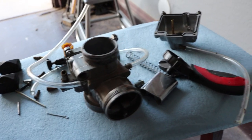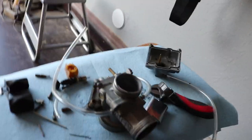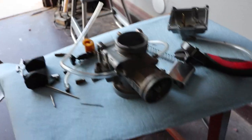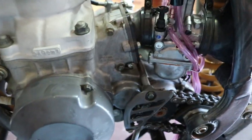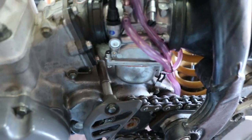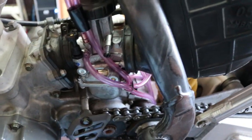Six and a half hours later. Alright guys, so we tried putting in this old carb but took it apart again, and the thing still idled like garbage. Changed some jets around, so I'm not happy with it. So what I went ahead and did is I picked up the PWK 38mm Keihin Carb — this is the Air Striker. I'm hoping that this does better. We just got done putting it in. I'm going to throw the gas tank on and throw the seat on real quick, see if I can get it fired up and dialed in, and hopefully this guy will idle.